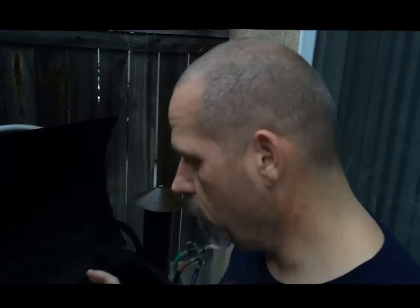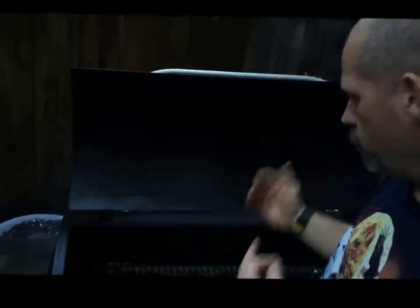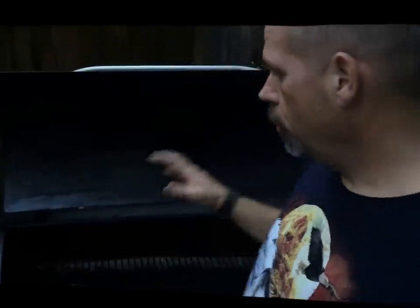Now, the startup cycle in the Traeger manual tells you between 10 to 15 minutes. It's gonna smoke and you must leave the lid open. A lot of people have been leaving the lids closed and they come back and they find out they got the air message. Well, why? Because you're not getting the air into the machine and you're not doing the proper startup, okay? So we're just gonna let this thing chill out for a little bit, 10 to 15 minutes.